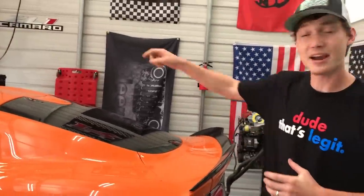So let's go ahead, and after we pump the brakes, I want to see if it actually brakes better, because we did have an issue with the car leaning one side whenever we braked, and there was tons of air on both of these calipers on this side. So let's go ahead, drop this thing, go down the road, and hopefully hit fifth gear.